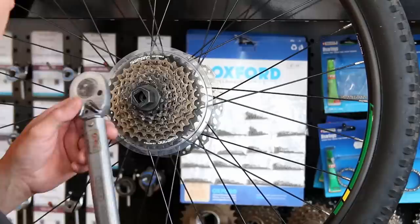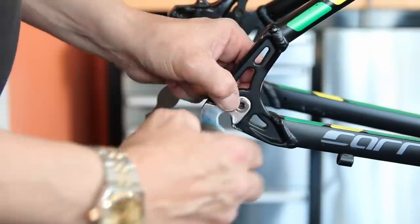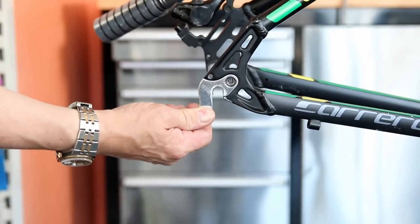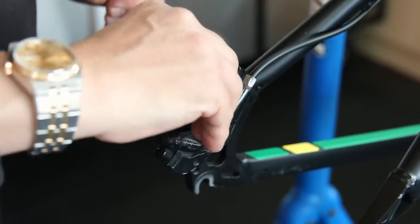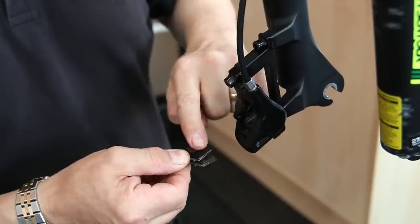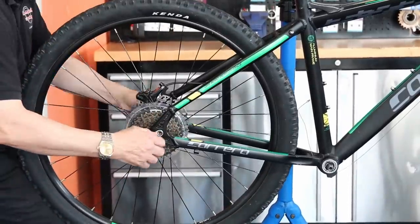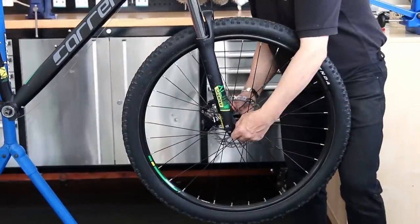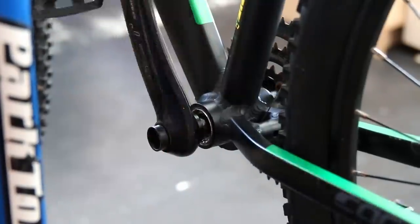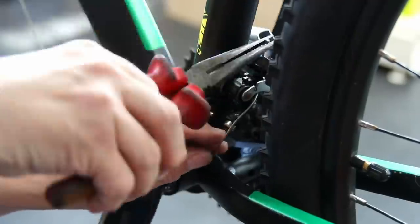The spokes and tensions were all fine on this bike. A bit of brake cleaner on the disc and we start the rebuild. We put the spoke protector on the rear of the cassette — I saw a wheel this week where it was missing and the spokes were damaged, so keep it on your bike. The derailleur hanger was loose, now torqued to 10 Newton metres. A little grease on the back of the brake pads stops the piston creating a rusty ring, and grease on the pivot point helps the brakes actuate and release more smoothly.